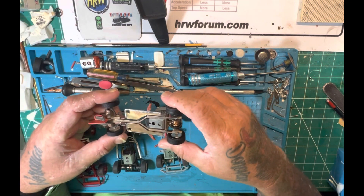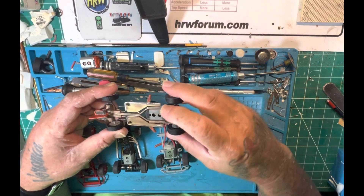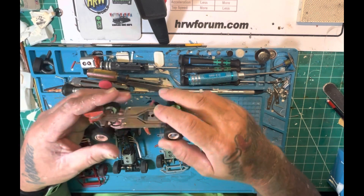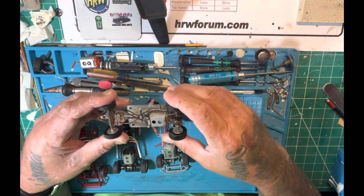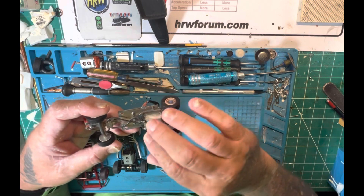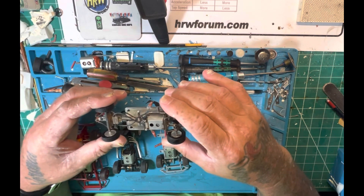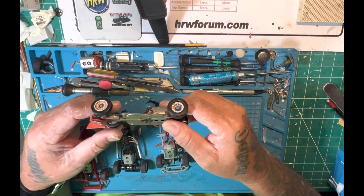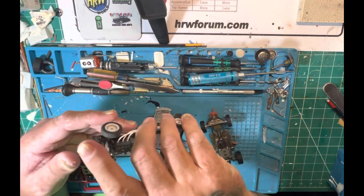This one is a little more complicated. This is a really old style — what they call a tuning fork chassis. You can see that Y-shape, and these pans — it's all hinged so there's movement in the chassis. You don't really need body float because if you secure the body to these pans, the pans cause it to float by itself. That's something we'll show you how to do as well.